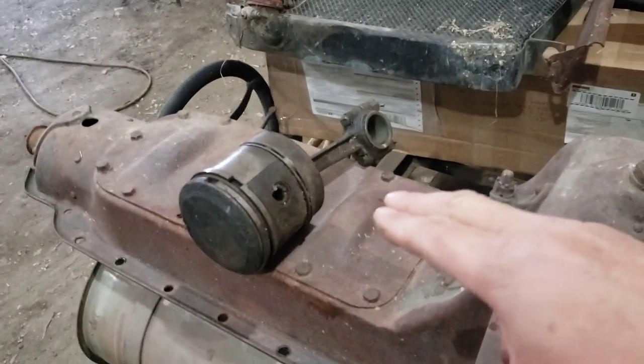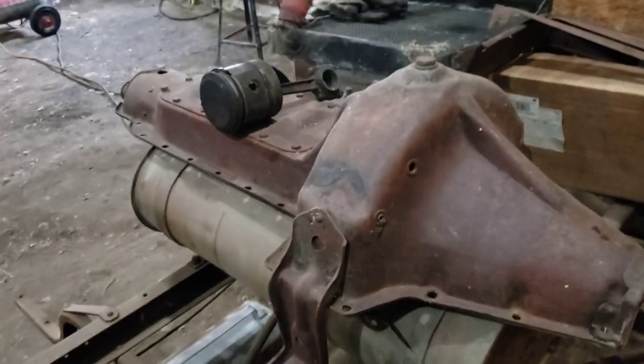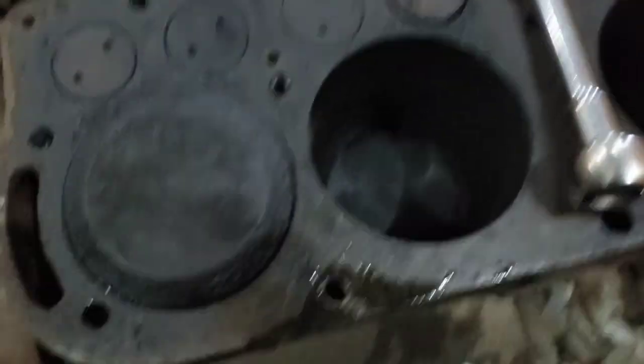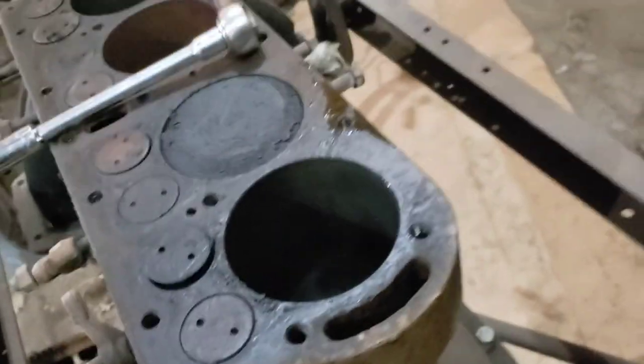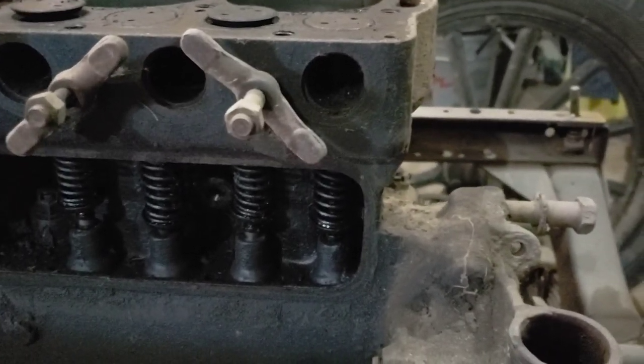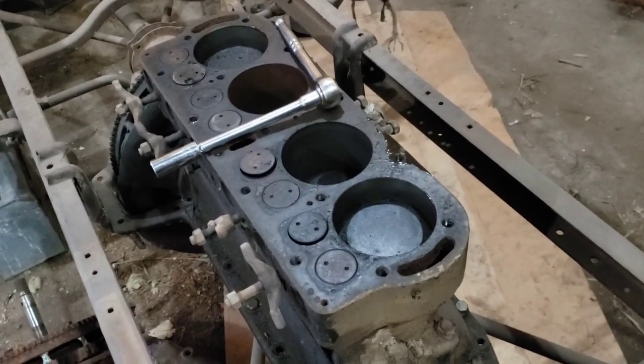When I bought the car, one piston was already out — I suspect the previous owner had pulled it to inspect the bearing wear, just like I'm doing today. That connecting rod looks good, though in the meantime the cylinder has rusted over from sitting. There's no ridge anywhere in the bores. The engine turns freely and the valves open and close. My goal today is to assess the bottom end — bearing condition on the mains and the rod bearings.